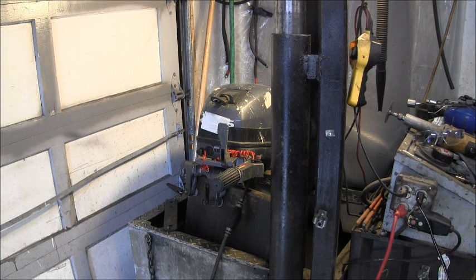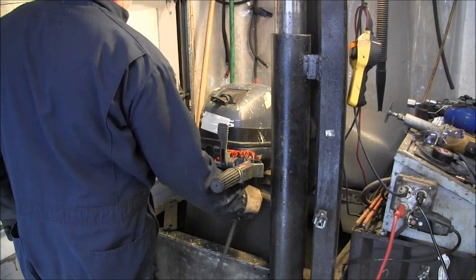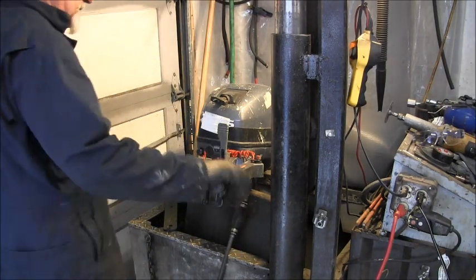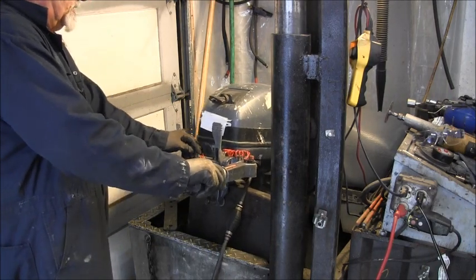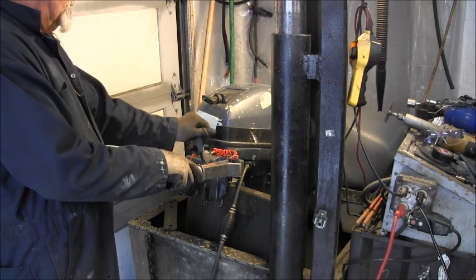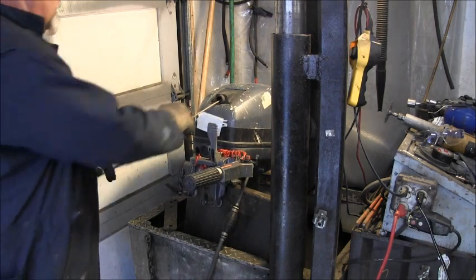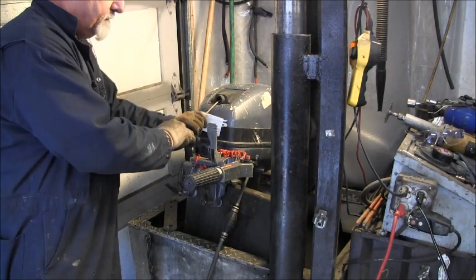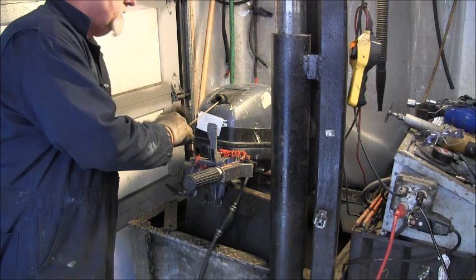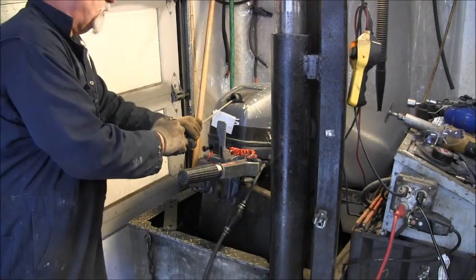I got the little 15 Yamaha in the tank. Let's squeeze that bulb. It is ice cold, has not been started. You'll see what I see. A little stiff. Okay. This one's in neutral. Let's make sure she pulls over okay. Alright, let's see. Choke's out. Bulb squeezed, we're in neutral. Short pull rope on it.